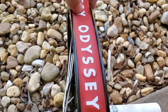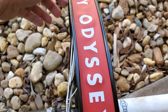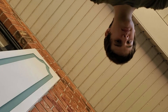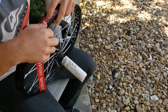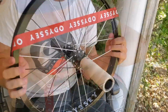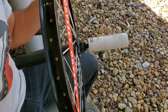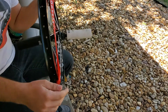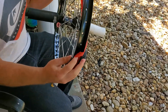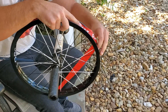Just keep pushing it out like that, getting all the air bubbles out, making it nice and flat and in the middle of the rim as much as you can, like a sticker. When you get to the point where it's got a lot of tension on it and you're trying to pull more but it's pulling it back out, sometimes I'll try with my knee — you can kind of clamp it against your knee down here and then keep working it.